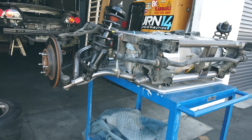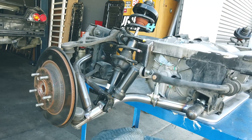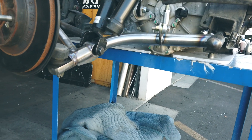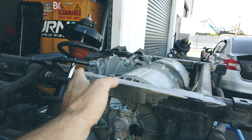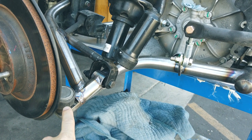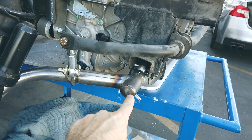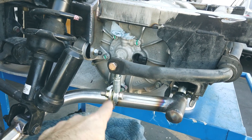Let's do a little walkthrough with pretty much everything going on here at Eimer Engineering. This is the motor on the cradle — we had to pop it out because Chris was making the rear batteries. You can see what Chris from Wisecraft did: the skid plate is incorporated with the mounting brace between the front and rear part of the subframe. The subframe was actually widened and stretched back eight inches to accommodate the giant Tesla motor drive unit. The lower arms were custom offset — we have factory pivoting points, factory shock point, and then the lower dog arm goes about eight inches further back and bolts to the factory-but-moved rear subframe.